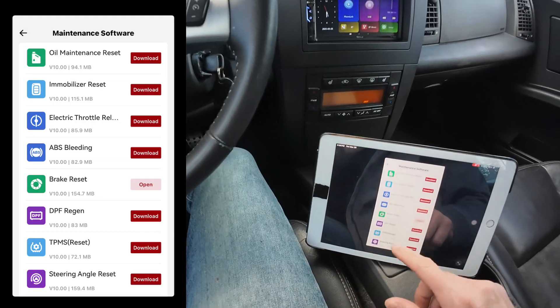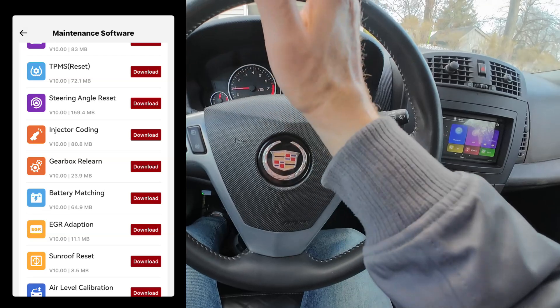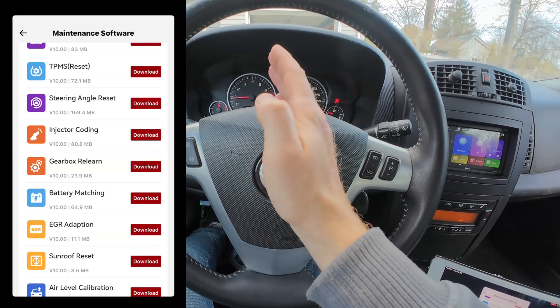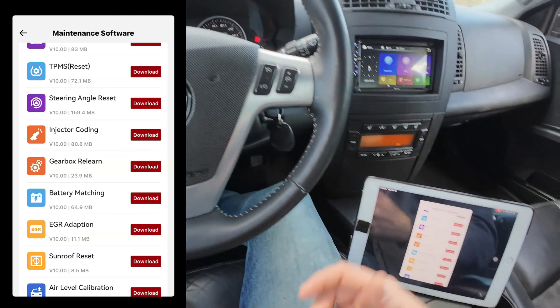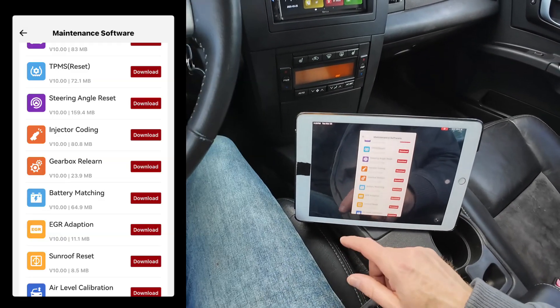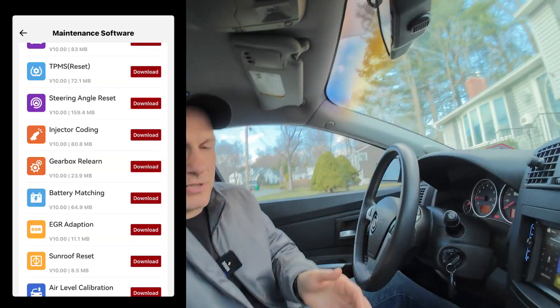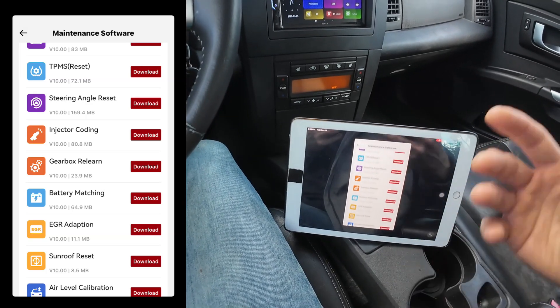Steering angle reset — when I first obtained my Acura TL, my friend had hydroplaned and when the vehicle struck the curb it cracked the subframe. The steering wheel was off by 45 degrees just to go down the road straight, so I had to recalibrate the steering angle. I bought a Foxwell scanner for $160 and used it just one time. This can do a steering angle reset. Battery matching — going back to the Audi S4: if you have a Mercedes-Benz or some BMWs, you can't just replace the battery because you may damage the alternator and the new battery. When you swap out the battery, you have to tell the vehicle's computer there's a brand new battery installed and it updates the system.